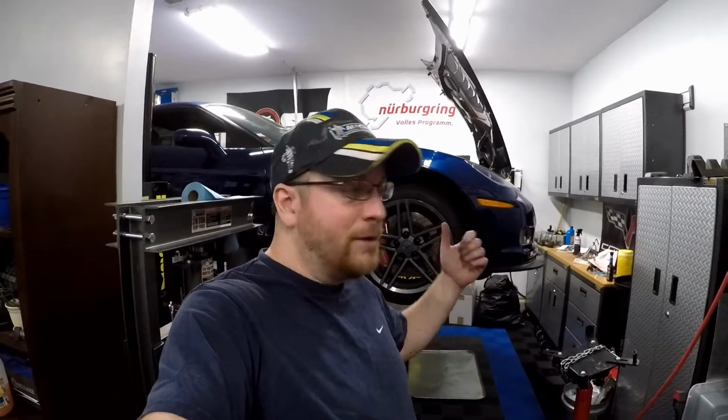So hopefully this was just a quick overview of identifying the problem. In my case, drilling a hole through the oil pan with too long of hardware, replacing the oil pan, dropping it, putting in the Improved Racing crank scraper, the baffle, and that oil pickup tube brace. All those parts, putting the oil pan back in, and torquing everything back down. Overall, guys, this swap wasn't that hard.